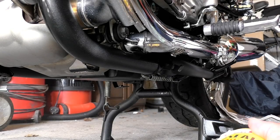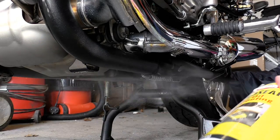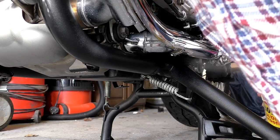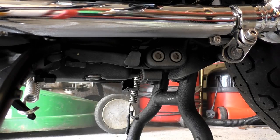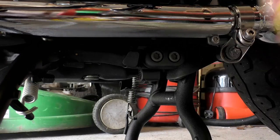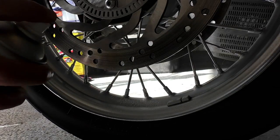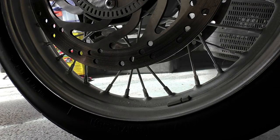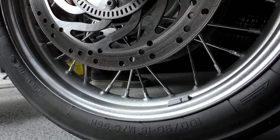If you use the bike in all weathers and have no alternative, you may want to expand this and treat more of the bike, or even all of it. A word of caution though: keep it off your tyres, off your brakes, and off all your control levers and footpegs. If you do get it on any of those surfaces, clean it off thoroughly using white spirit — in the case of the brakes, use a proper proprietary brake cleaner. In spring I clean it off the visible parts for aesthetic reasons and reapply it in the autumn. Wax Oil can be used on surfaces that don't exceed 50 degrees Centigrade, so for the engine and exhaust you'll need to use something else.